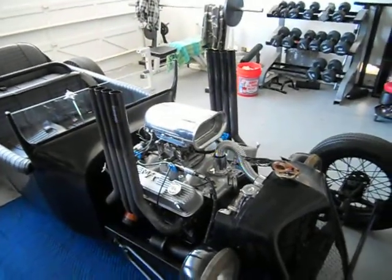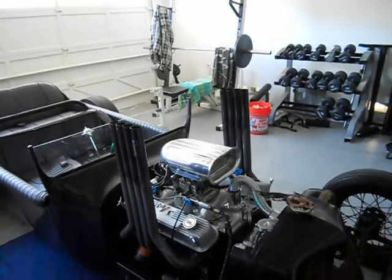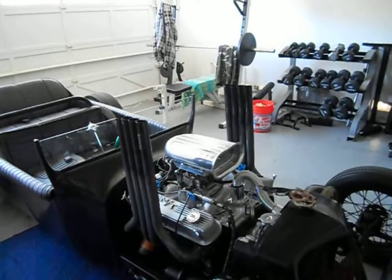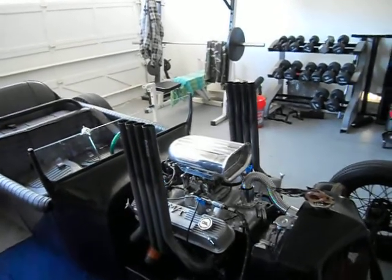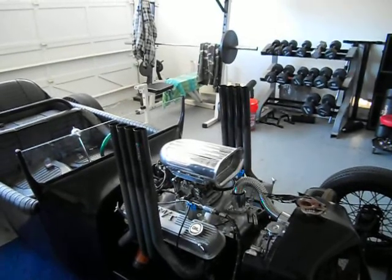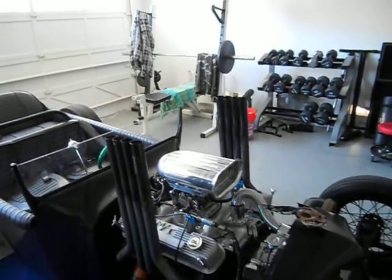So I decided to do a new rat rod video update. Haven't done one of these in a little while, and there's been some cool new stuff added to the rat rod. I was having some overheating trouble, and talked to some of the old timers at a couple of the car shows, and come to find out that I wasn't running a thermostat.